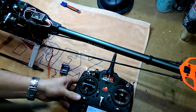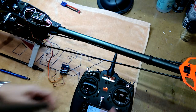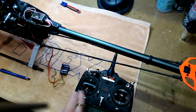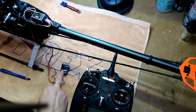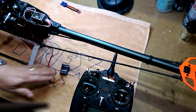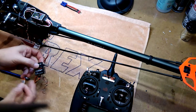Back out. Now you're armed, so unplug your ESC and close down your radio. Here's the important point: you need to rebind your receiver at the low stick position in order to truly activate the fail-safe and have things work properly. So we're going to go ahead and do that.